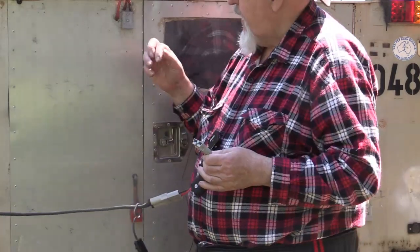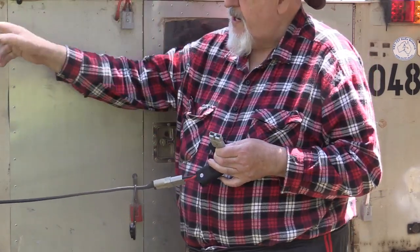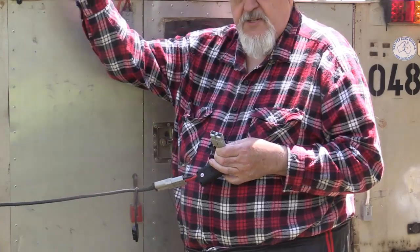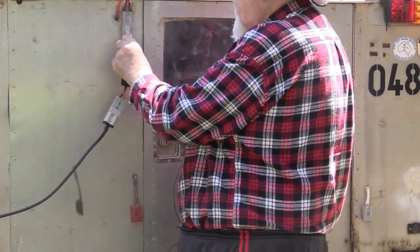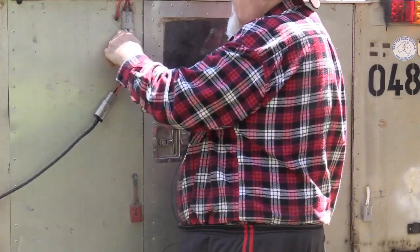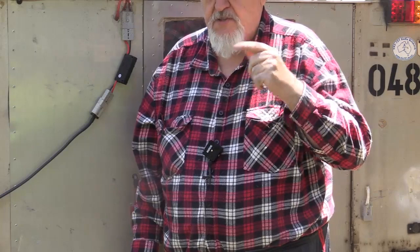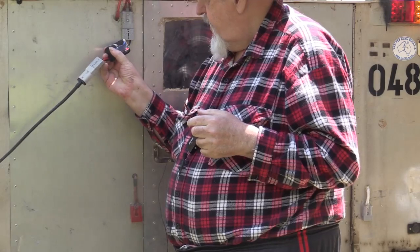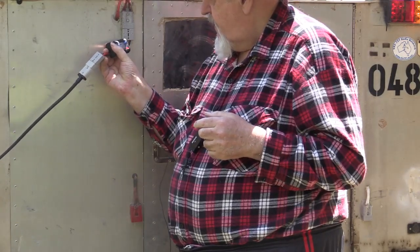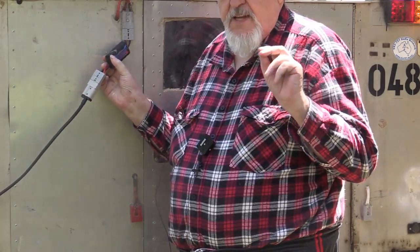On the back of my car I've got an Anderson plug here that goes directly into my regulator, which runs off the front solar panel into the fridge battery. The fridge battery is down under this side. All I have to do if I want more power in the fridge battery is bring the solar blanket back here, plug it in, and I'm using the car's regulator rather than the one that came with the blanket. It's now pumping power into the battery — it's only taking 0.4 of an amp because the fridge battery is fully charged, but that's how I charge that battery.